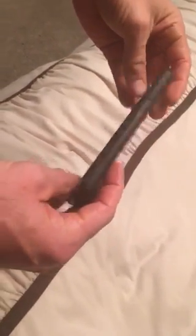There's an iPhone 6 glitch where when you plug your phone in, it just automatically turns off. You can't get it back on, restarting isn't working. Took it into a Verizon place and they said to push down this little side button here and this button here simultaneously until the little Apple logo appears.